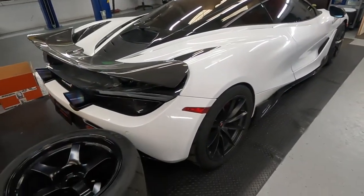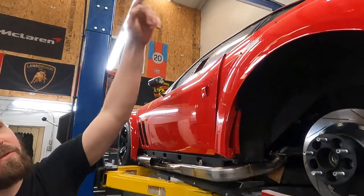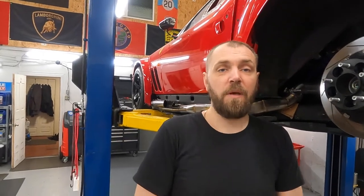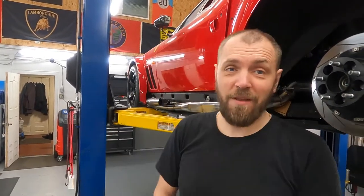When she finishes, we move the car to the middle of the shop because the 720 engine is coming really soon — I think next week. We need to finish the BMW and the 720 first, then that car goes to the middle spot for powder coating. I'll start work on the side vent and fuel tank, and when everything is assembled the car goes to the dyno. We need to tune this car for 92 octane pump gas and also keep a tune for 109 octane race fuel — we have to buy fuel to test how the 109 performs.